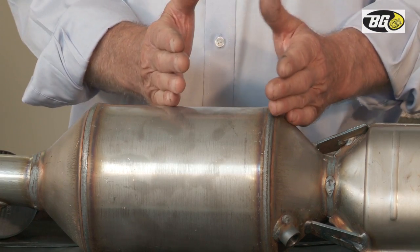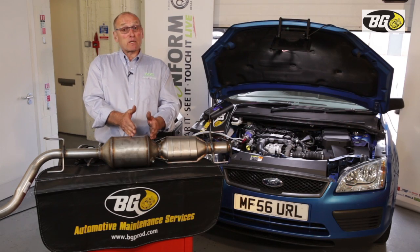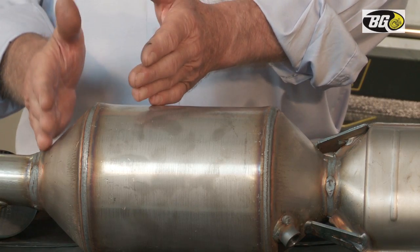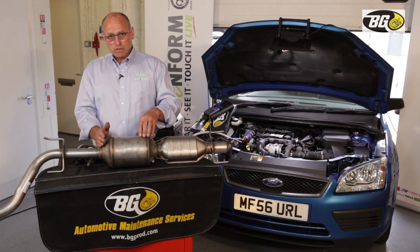The leading edge has a zonal platinum coat — more platinum at the front and very little at the rear — so the platinum helps convert the soot into carbon dioxide, with storage of untreated sub-particles at the back end. It's important that that platinum coating is there.